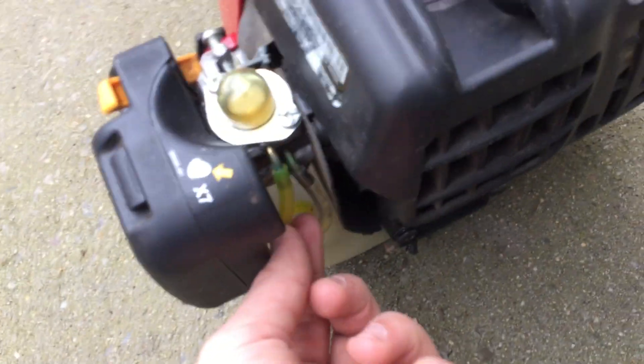What I did was, the fuel lines were actually the problem - they were all rotted, they were non-existent. But he said he only used it a few times, and I couldn't believe that. Look how clean this gas tank is - it's literally like brand new. Only problem was the vent in the gas cap broke, and I glued it, but how long is glue going to last? It could be a week, it could be a month, so I just bought a new cap.